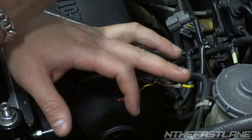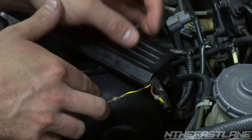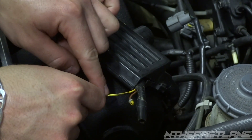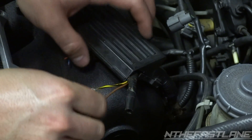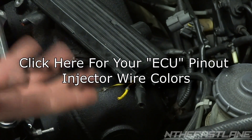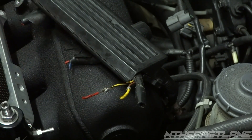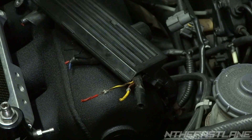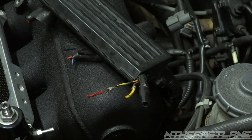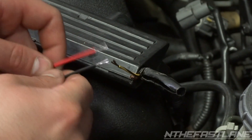This is OBD1 — I had the prior one with different clips soldered on. For OBD2, this is a 98 Civic chassis. On here, the yellow with the black stripe is your positive and the brown is your negative. You can reverse the polarity — put the black wire to the positive and the red wire to the negative — but if you do that, make sure every injector is set up the same way. Whatever you do on the first one, do that on all four.